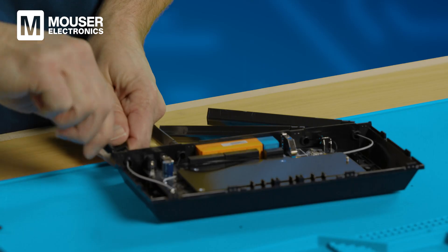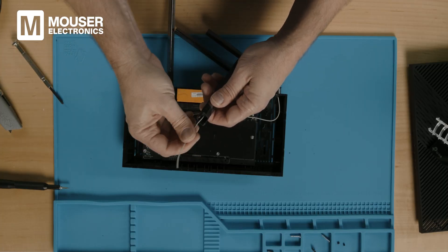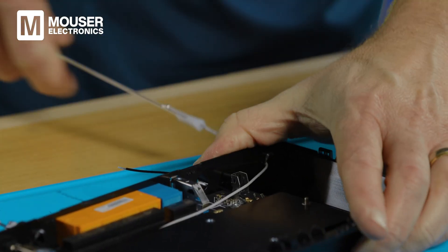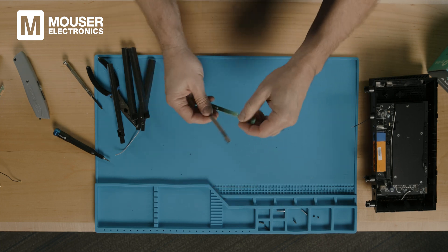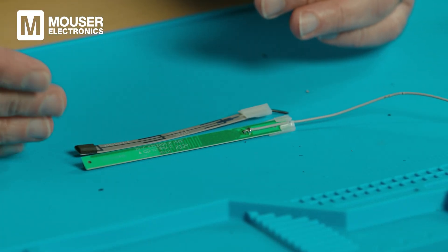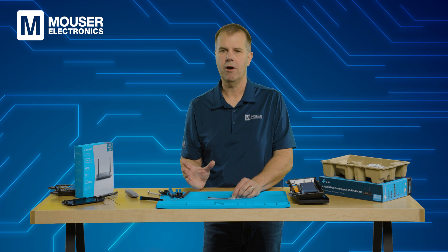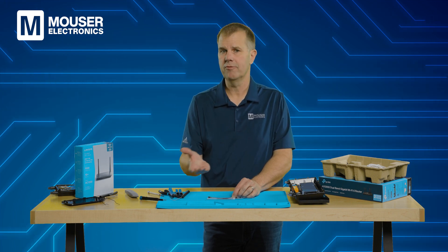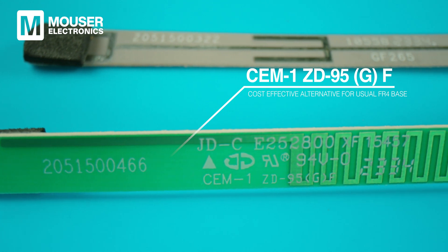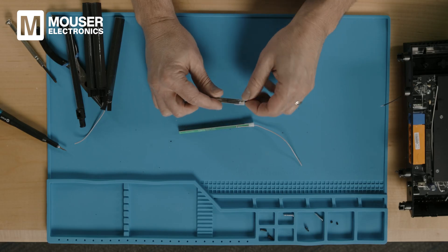Let's open up these antennas. Inside this antenna they've epoxied it in, so I had to break it open. These antennas are massively different — different colors, different sizes, vastly different antenna designs, manufacturing technologies, and even substrate materials. This Wi-Fi 6 router supports radiation pattern beamforming, which can target RF energy towards connected devices like your TV or phone as you move around the room, improving signal quality and range. The green antenna uses a cost-effective alternative to the usual FR-4 base material. The brownish-gray substrate is a low-loss PTFE woven glass high-frequency material. Both use a solder connection for the cable to the actual antenna.